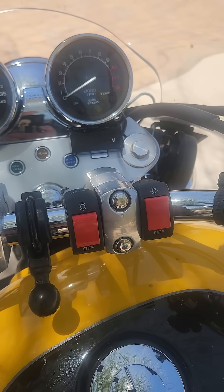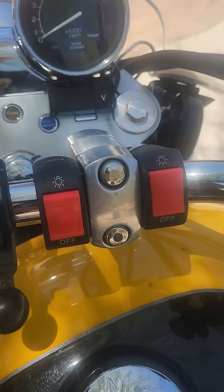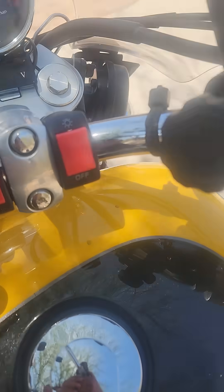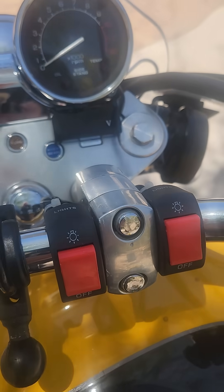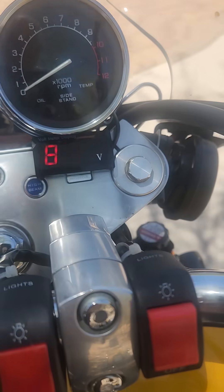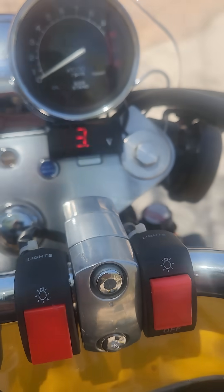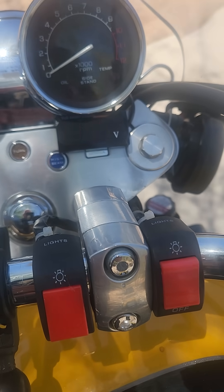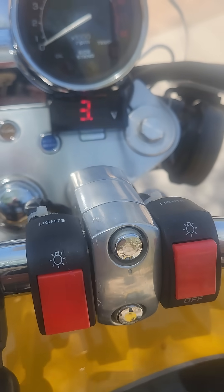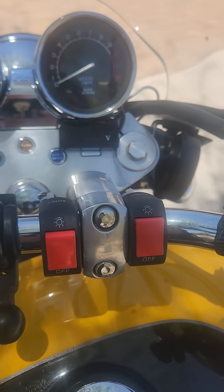I decided to upgrade my voltmeter — I hardwired it to the battery so it's going straight to the battery. But when you do that it never shuts off, so I installed a 12-volt cutoff switch right here. If I turn it on, you can see the bike settling at about 13.0. It's flickering like that because of some video artifacting, but it's sitting at about 13.0.